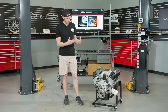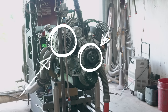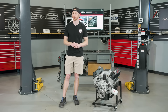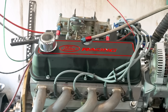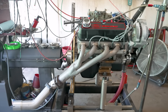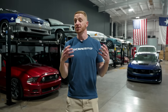Turning attention to the accessory drive: typically engine dynos just use an electric water pump and a harmonic balancer, but we wanted to be a little different and threw on a water pump and an alternator. Because of the reverse rotation water pump, we needed an extra accessory drive component to route the belt correctly, which is why we went with the alternator as well. Ted checked over the timing — all three runs were at about 36 degrees of total timing — and he made a few tweaks to the carburetor. Long tube dyno headers were used with down pipes to divert exhaust outside. You'll notice a little smoke at high RPM in runs one and two — we had a loose intake bolt that let a little coolant into the oil. We got that fixed, and the smoke is just residual burn-off.